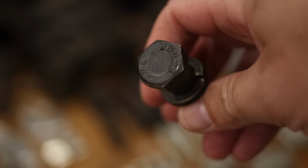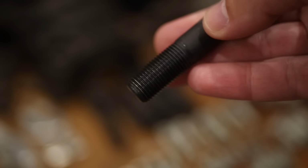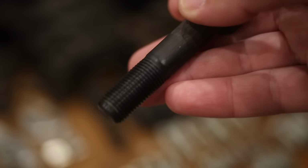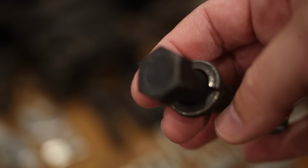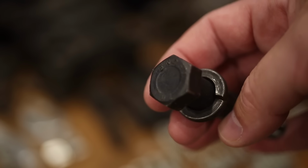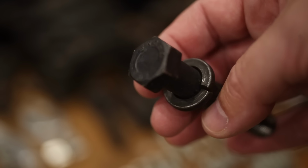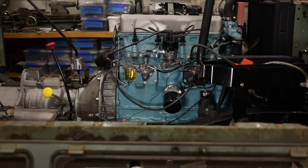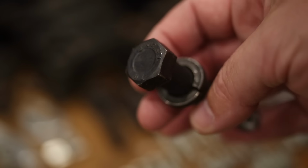There are different processes that result in slightly different chemicals, but the gist of it is that the black you can see is like a very thin, hard oxide sponge, maybe more like honeycomb. The black oxide itself has very little corrosion resistance, basically none, but it holds oil, and it's the oil that provides the corrosion protection. And the finish will last forever, so long as it doesn't dry out. That's why I think on a motor like this, which is likely to be kept clean, black oxide isn't so good. Nobody cared about rusty bolts on their Land Rover motors in 1970, but on a nice restored vehicle, you don't want all the hardware to turn brown.